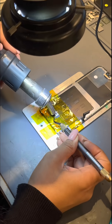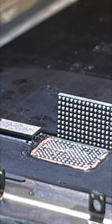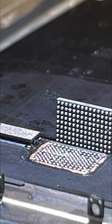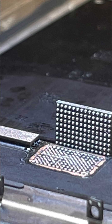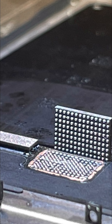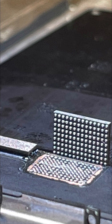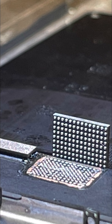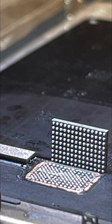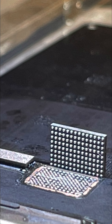I was laughing with Misha when she put the screen on the plate with loads of kapton tape around it — I'm super anti-kapton tape, I hate it — but she was paranoid about breaking the screen. This is the screen's integrated circuit. It was originally designed only to translate analog touch on the touchscreen into a digital signal so the iPhone could understand it. But the complex integration comes in where this same chip is now also able to hold memory information through the use of ROM — read-only memory — and I've detailed this in my blog.